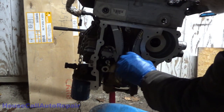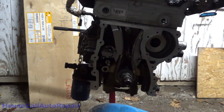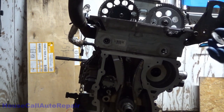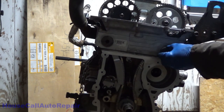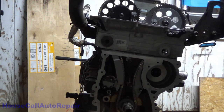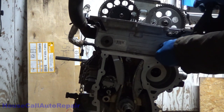And if you take these bolts back out, we gotta apply silicone here, here, and here, along the lip of the cover, and then put the cover on. And then these two plugs go in. What I'm gonna do is just set them in here for now. I'm gonna come back afterwards and put a little bead of silicone around the edge, because I think the O-rings that are in there are kind of flattened. We'll see. I'll make sure these things don't leak.